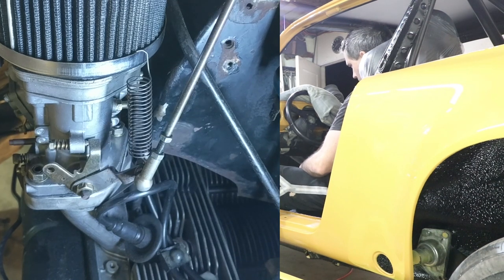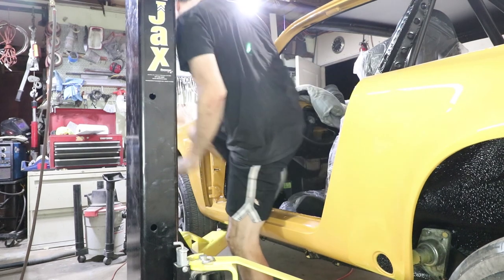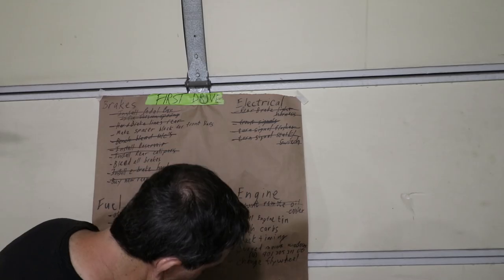Feels like that might be full throttle right there. I just went back and looked at that video real quick and saw that when I was pushing the gas pedal it felt like it was coming to a stop. I don't know if that's the bell crank running out of travel — looks like the fan shroud because it's not even mounted to anything; the fan shroud is kind of flexing and bending, which is typically not the case. I'm not going to run the engine anymore until I get all the cooling tin back on it, so that will be fixed at that time. So the linkage is I think done. It's going to probably require a little bit more fine tuning and adjustment, especially after I take the fan shroud off and put the better cooling tin on. I've been working on painting some cooling tin day by day, so now we can cross off the accelerator cable. That one turned out to be harder than I thought.